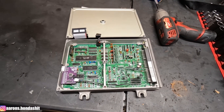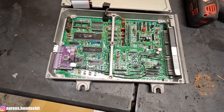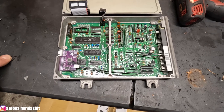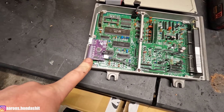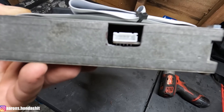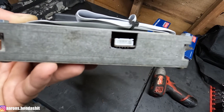You're gonna need to get some ECU modifications done to make this coil-on-plug conversion work. Here's the coil-on-plug board — see how it attaches to these pins? It goes in place of where the knock sensor board would go if your ECU is knock sensor board equipped. This is a chipped P28. I have an Ostrich and a Q-log in the ECU as well. The P28 doesn't normally come with a knock sensor board but it has the pins to be knock sensor board capable. I did not install this coil-on-plug chip myself — I had a friend do it. I don't quite trust myself with circuit board soldering yet. Burton Racing will install it for you if you ship them your ECU, so that's another way to go about doing it. Here is the coil-on-plug board sticking out of the top of the ECU as it's mounted in the car. This is where you're gonna plug your coil harness into once you have everything installed.